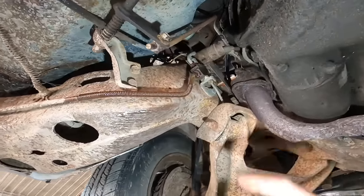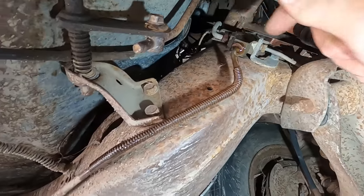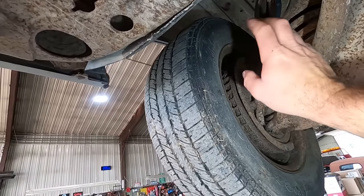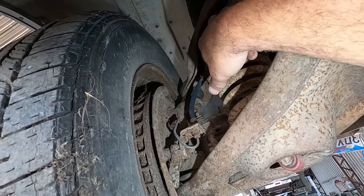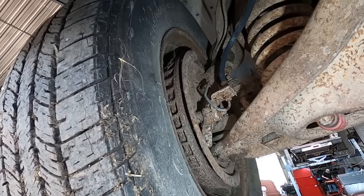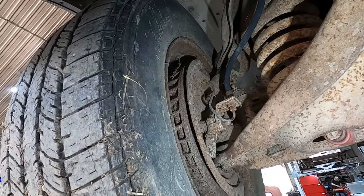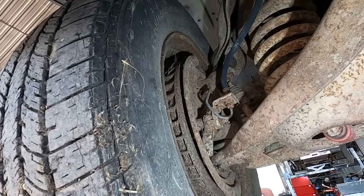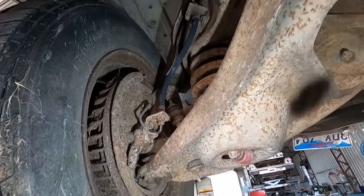All right, well, I think I found out where our brake fluid's going. It's not leaking at the proportioning valve. It's leaking from the master and dripping down to there. So, probably needs a master and hoses and wheel cylinders, but look at this. Hoses go from the frame down to this bracket here and then steel line up to the wheel cylinder. Usually it's just rubber hose from the frame into the wheel cylinder. So I don't know what GM's better idea was here with that chunk of steel line, but it just seems like one more spot for it to leak or rust out or whatever.